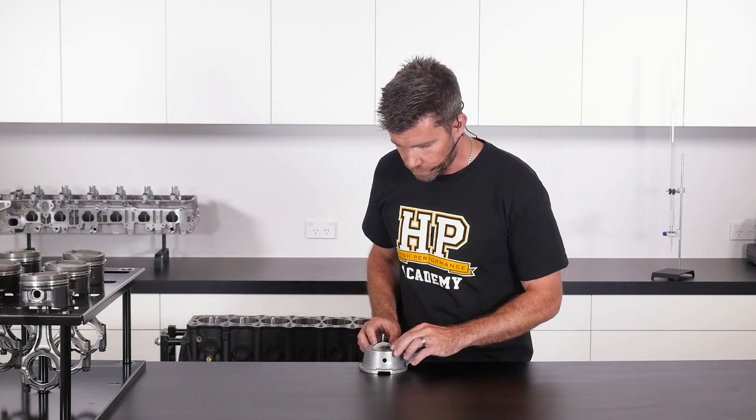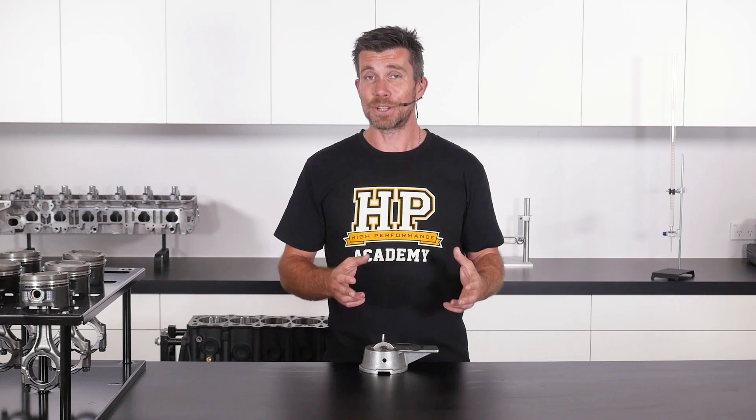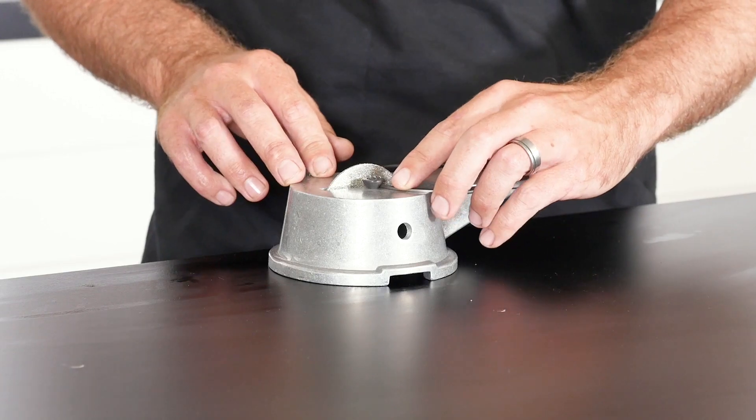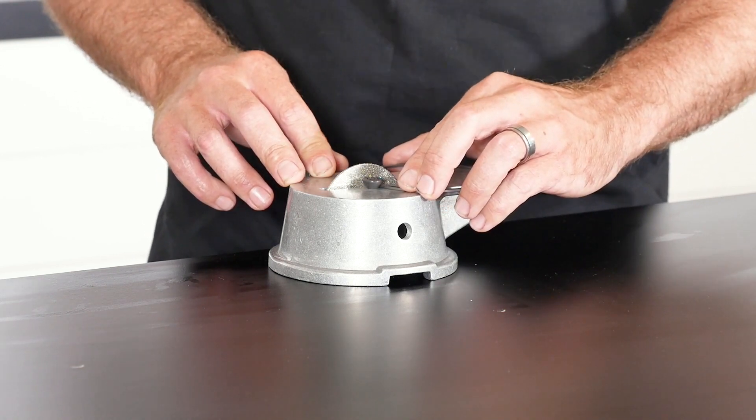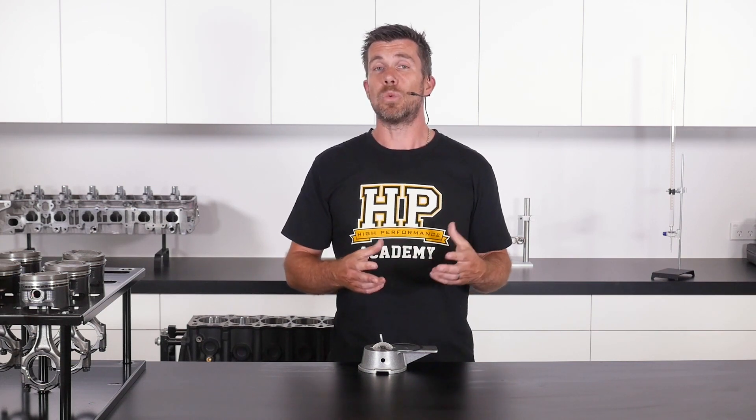What we're going to do is grind one side of the ring only. This requires a little more attention — we need to manually view the end gap of the ring and make sure we're always holding the end of the ring square against the grinding wheel. We're going to constantly make small adjustments: grind the ring, then take it off and check it in the bore. This lets us check our progress so we don't end up with an end gap that's too wide, and ensures we're maintaining a square ring gap. Apply gentle pressure against the locating dowel and against the grinding wheel, then manually turn the grinding wheel to remove some material. It's an iterative process — constantly rechecking progress in the bore, creeping up slowly on our end gap without going past it.